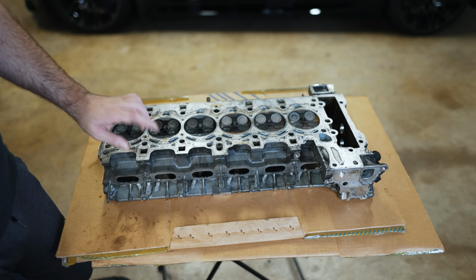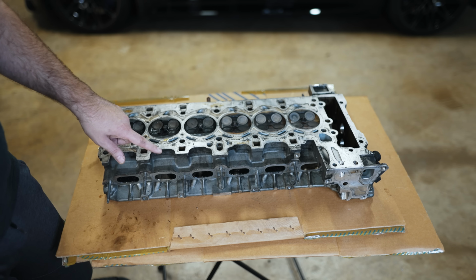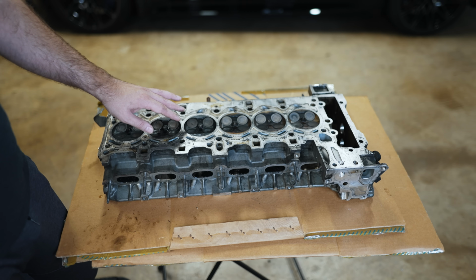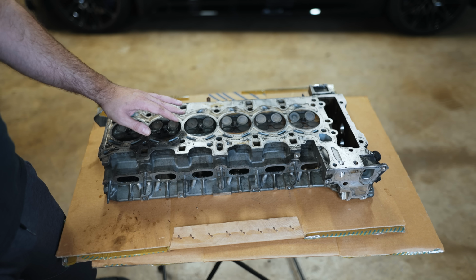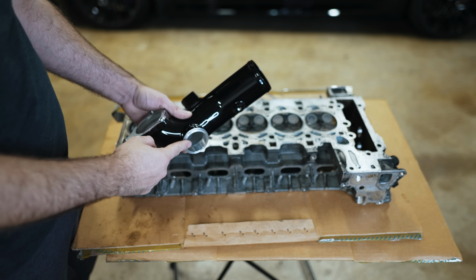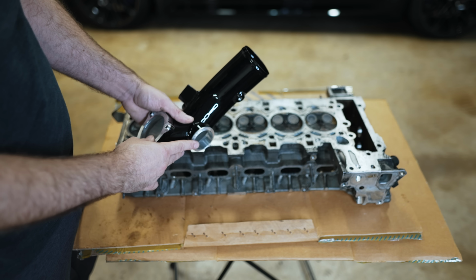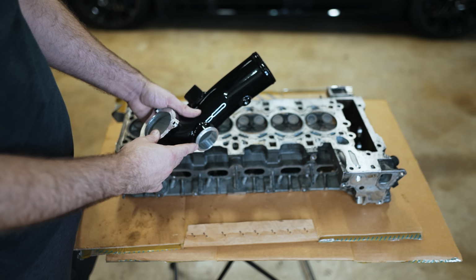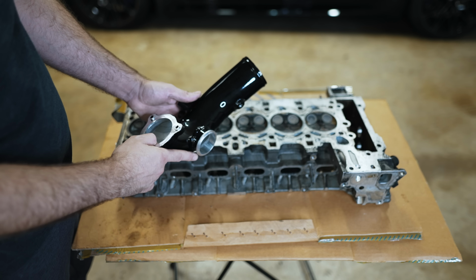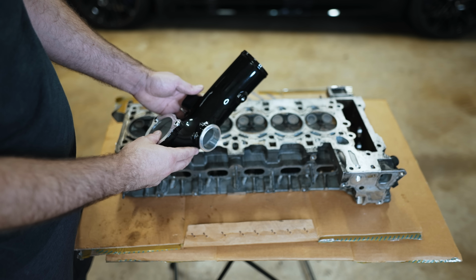So hopefully you've gathered that it's not as bad as it used to be, where you're getting unmetered air vented to atmosphere, because that air would have just been bypassed through the combustion chamber via a combination of the wastegate and the valvetronic system. So we're at this point in time where 5 years after the car came out, we're adding technology from 10 plus years ago just for the experience of it. It would be akin to buying a manual car in this day and age, when it doesn't really make any sense from an efficiency standpoint. In terms of fuel consumption or emissions, based on the way these cars are designed, it wouldn't make a difference, because that gets dumped to your exhaust anyway.